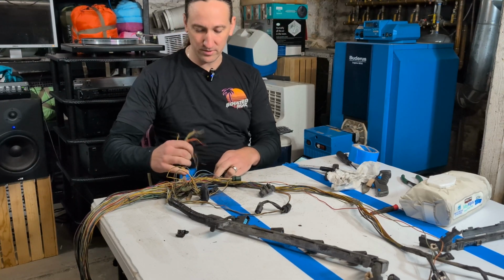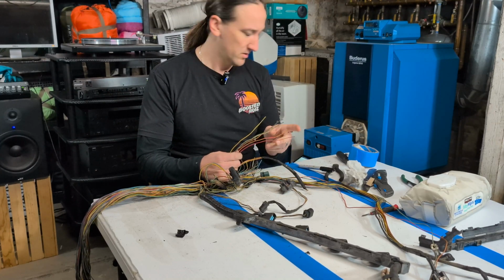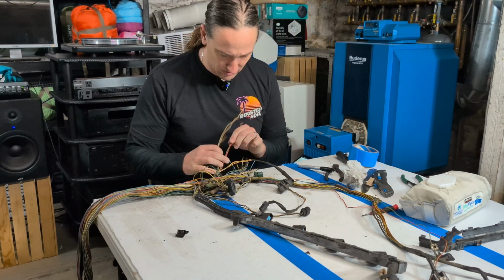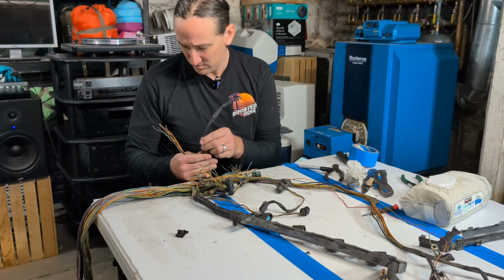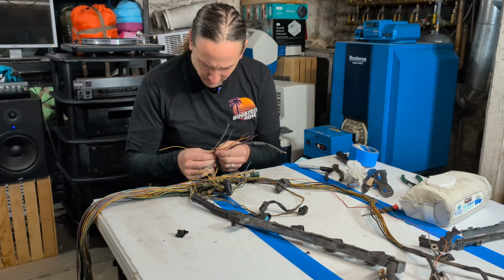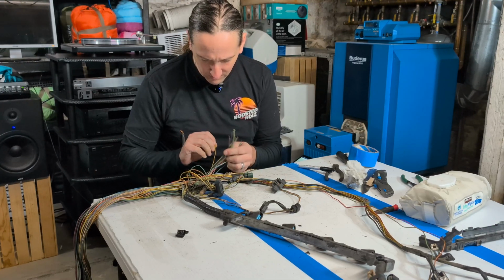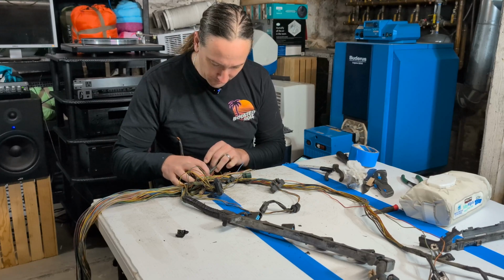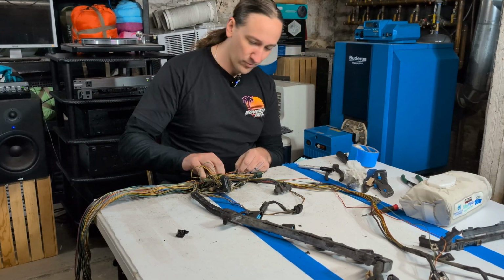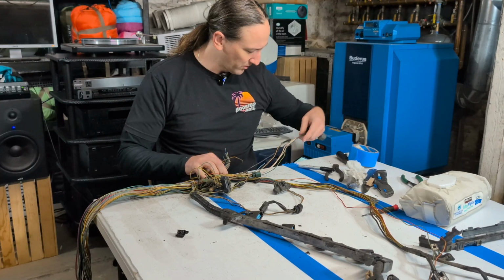The backup light switch. So that makes sense, right? Because you've got basically a reverse sensor on the transmission output. Should be yellow and green-white. Ooh. It's just going to be 2, so it's not that. I don't see any just yellow. I think in here there's just yellow. But is it near a green with white? Yeah, there's a green with white in here.